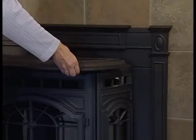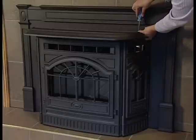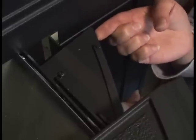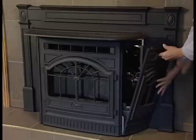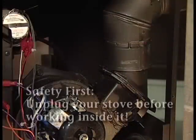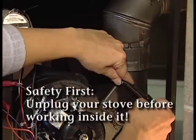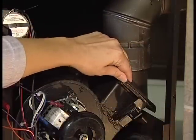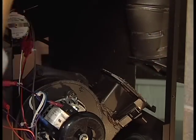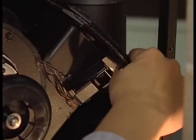To remove the sides of the cast insert, loosen the screw on the top right corner directly under the cast top, but do not remove it. Press upward on the frame with your thumb to relieve pressure on the side, then slide the side downwards. To clean the rest of the venting system, reach in and unlatch the trap door that is connected to the rear of the exhaust blower. Use a small vacuum hose attachment to clean the area. Close the trap door and relatch it.